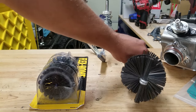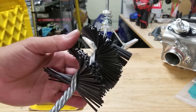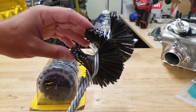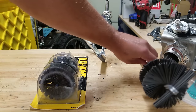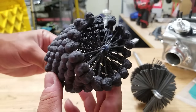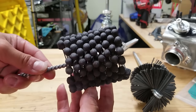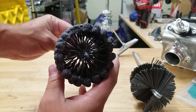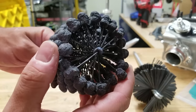Herb's main pick was the flex hone. This brush hone here is from Wiseco — I chose it because it specifically said 'safe for two strokes.' It is a good hone, however it's not quite as aggressive as the flex hone and probably wouldn't have gotten the job done. So I decided to go with the flex hone — that's why we were waiting so long. The flex hone is also known as a dingleberry hone or ball hone. Brush Research Manufacturing prefers the term 'flex hone,' but they're essentially all the same thing.